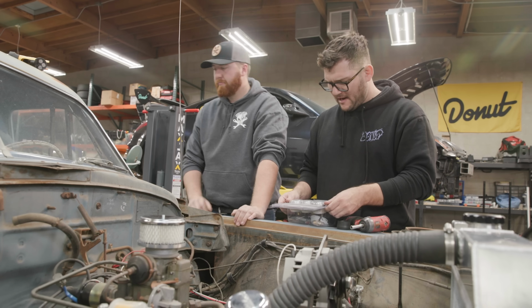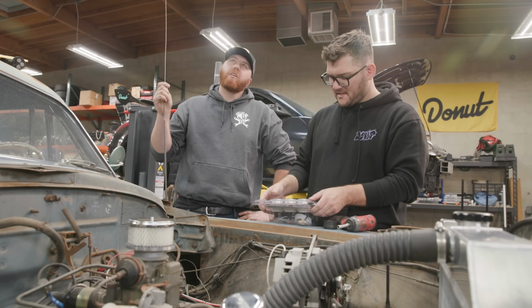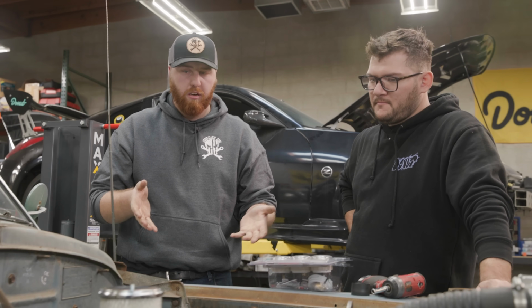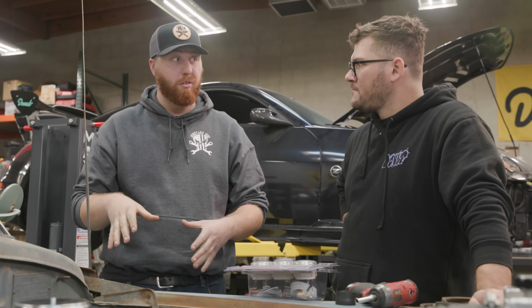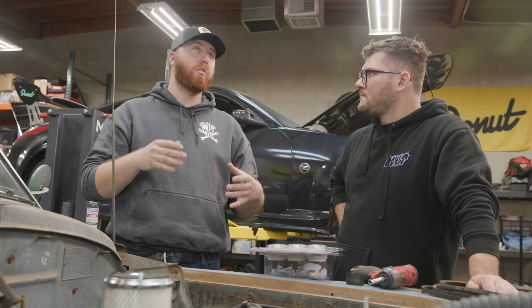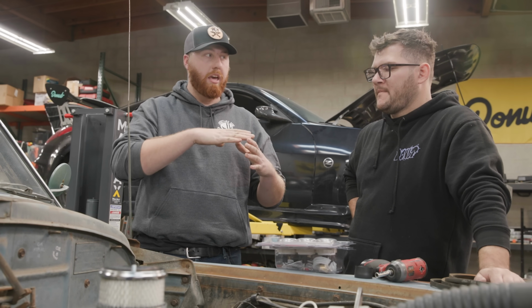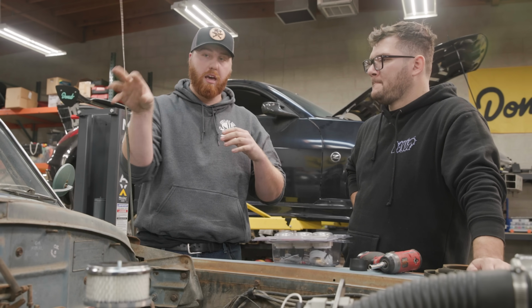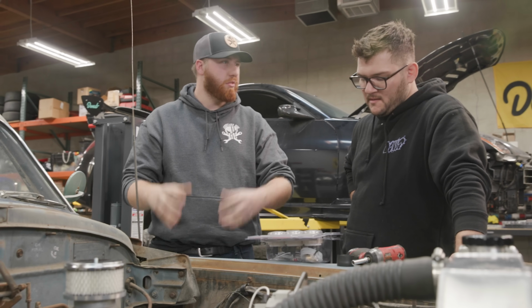Prior Kevin knew what was going on way better than today's Kevin. Oil pressure, water temp, and voltage, I feel that's like your basics. Another thing you can run, which I may suggest, especially since we're converting this car to 12 volts, you're going to have to put in a 12 volt fuel level sending unit, and then match that directional ohm reading with that style gauge. Then you can put it in one of these next to it as an aftermarket fuel gauge, if you know what I mean.